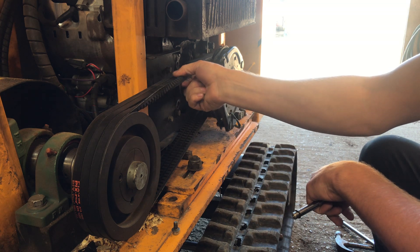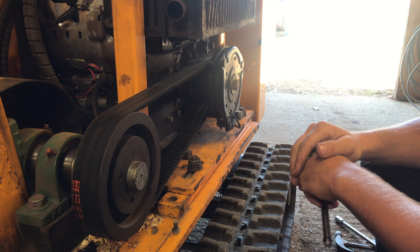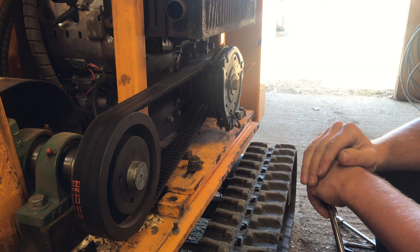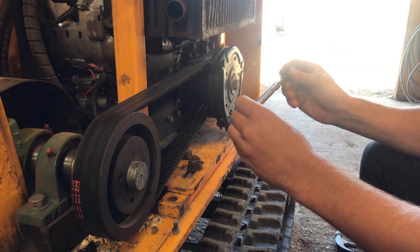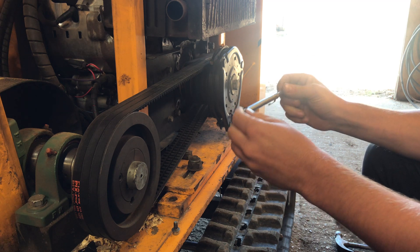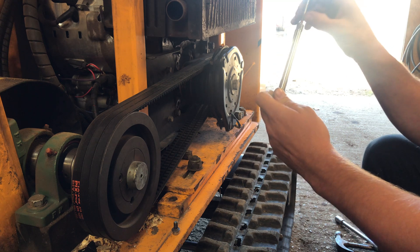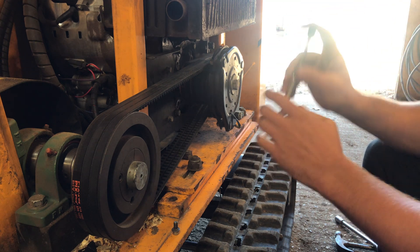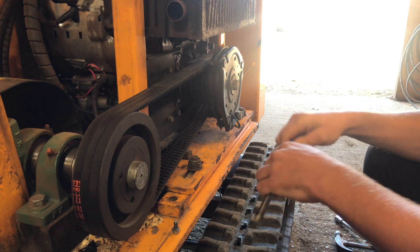I can turn those belts 180 degrees, and my partner who was in there earlier could barely struggle to turn it even a third of that. So it is important to have the gauge and use it correctly and know how to use it and have the figures available. The figures are again 7.1 on the lower half, and the reading you are looking for is 2.5 on the top. These are approximate — do feel free to look at the chart and correct me if I'm wrong.